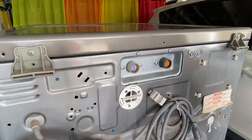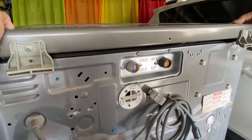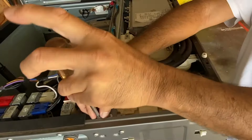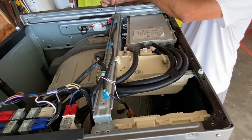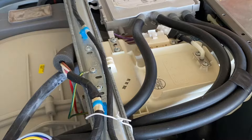Remove the two screws from the two rear lid brackets. Slide the lid back about an inch and then remove the lid. Remove the four screws holding the mounting bar. For other washing machines, check out an appliance parts website like AppliancePartsPros.com — enter your model number and check out their videos.